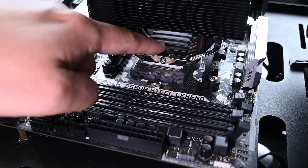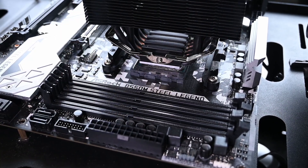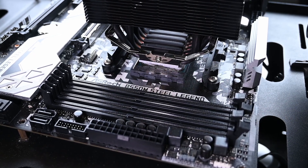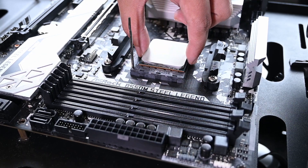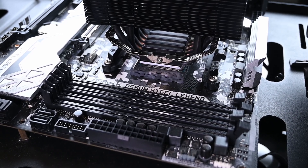Do not get any cooler with this kind of mounting mechanism, especially if you're an AMD user. If you're an Intel user, I don't see a problem, because Intel processors have a secure bracket mechanism — Intel uses LGA and those are fine with this. AMD uses pins, not LGA, which is why this is an issue. I hope this has been educational and may your processors have a long life and not be damaged. Thank you for watching, if you like this content please share it — I'll see you guys in the next one.